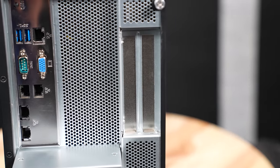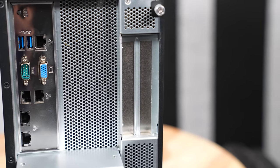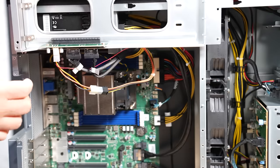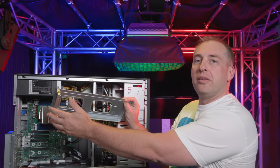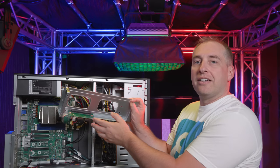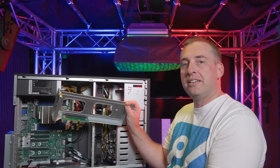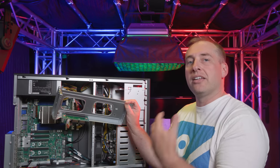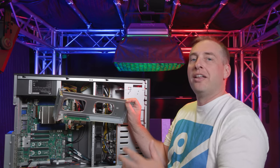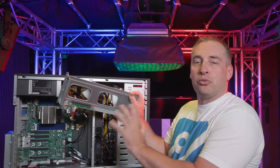Another feature on the rear is that we have two expansion slots sitting above the rear I/O. That was actually really interesting when we opened the system. You can see that you have the rear expansion slots, but then there's a PCIe riser that comes up and services them. This was actually a way for Tyan to expose more PCIe lanes in this tower form factor than if they just had normal PCIe expansion slots below. They have plenty of those too — we'll get to them in a second.